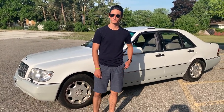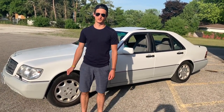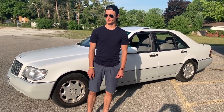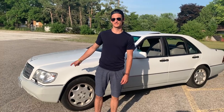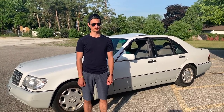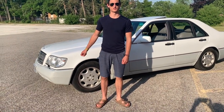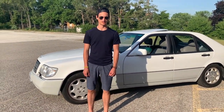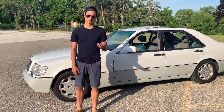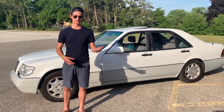Hi everyone, welcome back to the Vences Mercedes garage. Today I wanted to give you an update on my W140-300SD rodbender project. For those of you that aren't familiar with the rodbender, the Mercedes OM603.97X engines built between 1991 and 1996 were bored to 3.5 litres, but they kept the original components from the OM603.960 engines made for the W124s between 1987 and 1996. Since they were bored for 3.5 litres, the pistons were too big and they wobbled around, essentially bending the rods.